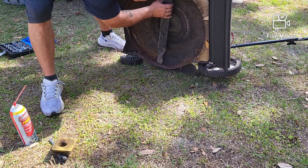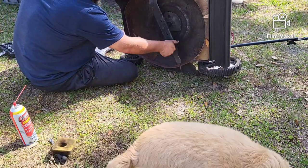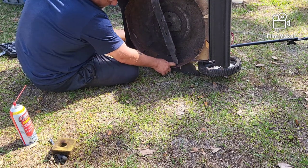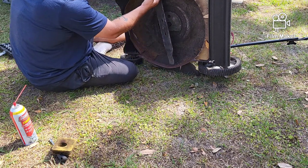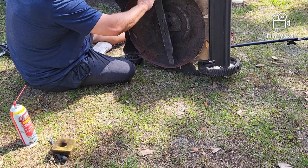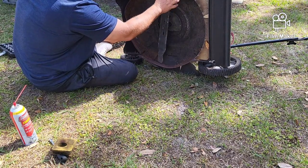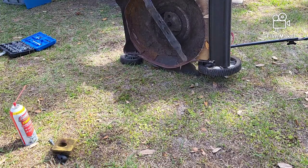The blade is actually hitting the side here and not that other side. I'll tell you what a quick fix is going to be for that. I'm going to get my ball-peen hammer and we're just going to persuade this out — it looks like it's bent just a little bit. What's happening is we're hitting the side of the machine right about there. So I'm going to go get my hammer and we're going to persuade this thing out of the way.